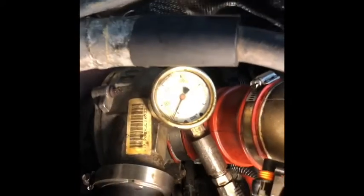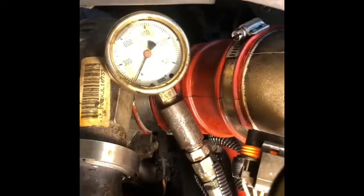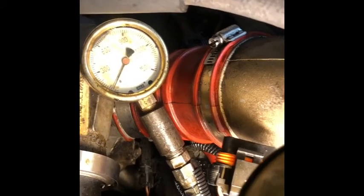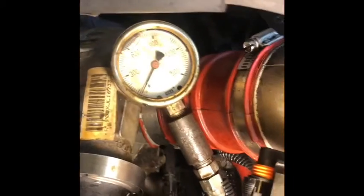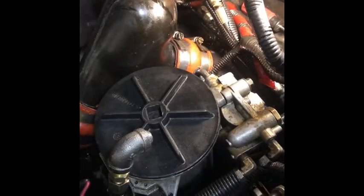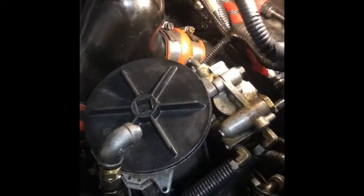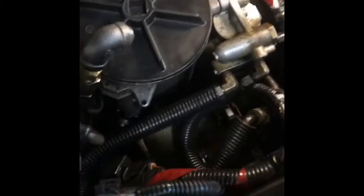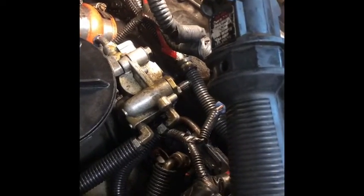It's going to take a little bit, because when the oil pressure hits it's going to start bouncing. I checked it earlier off one side and was hitting 600 PSI at idle. The F-350 should be about 600 PSI at idle and 2800 PSI under load. It's pretty simple to do — gets your hands a little dirty, but it ain't that bad. Thanks for stopping by.